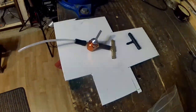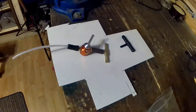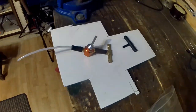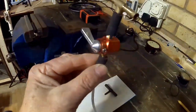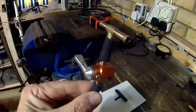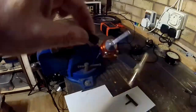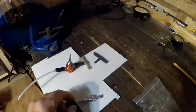It was a little bit awkward to bleed air from the system, but two or three attempts and it's done. What you must do — or what they advise — is mount this vertically so that if there's any air in the bottom of the pipe it goes to the engine fuel and not the other way where it picks up air. So that's how I did the fuel line to the diesel heater.